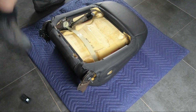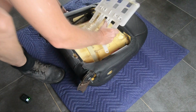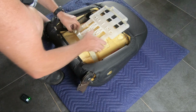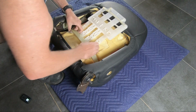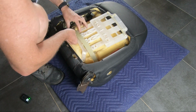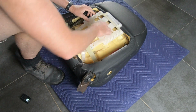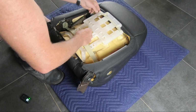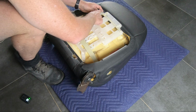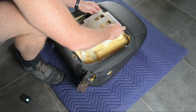With the back section, I'm going to show you the fix that I came up with. Use some really big, heavy plastic zip ties, and then did some plastic welding, melted the cracked plastic back into position, and then used the zip ties. So the zip ties actually will share the load between the springs, and hopefully that will last quite well. I'm just explaining what I've done there, and yeah.